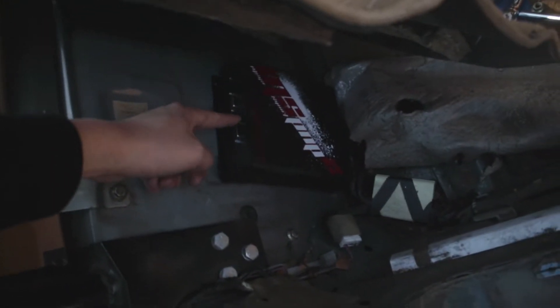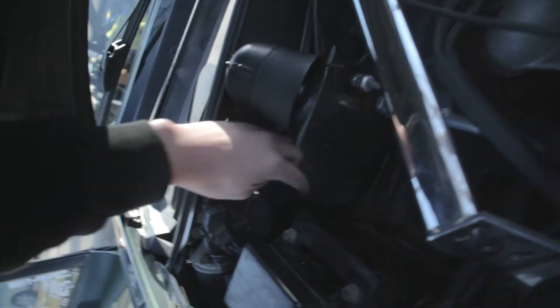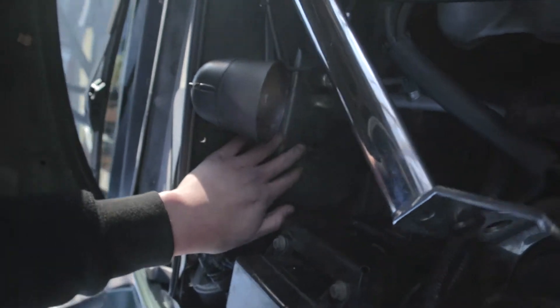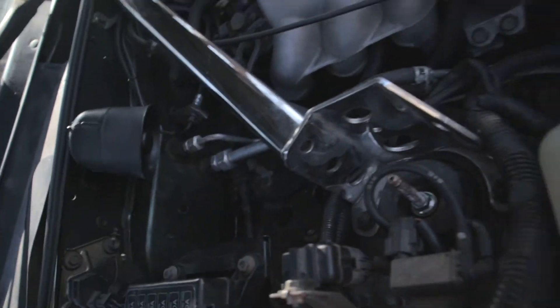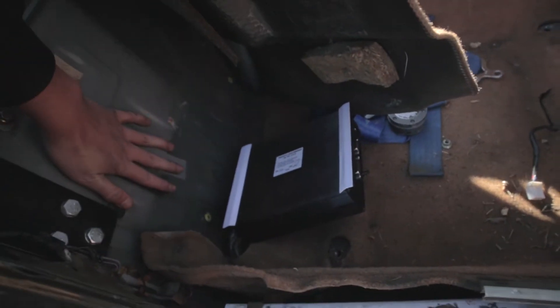The map line is going to be run from here on the ECU in through these plastic tube things. Once it gets up here, I've got to find that rubber grommet in the engine bay that we have to poke it through. Actually, I just drilled a hole in my firewall right there because that grommet was just not accessible. I drilled this one the same size and stole the grommet from that, drilling a hole in it so the map line can go through without getting snagged and cut. I need to clean this area up and hopefully this will stick and not dangle around.